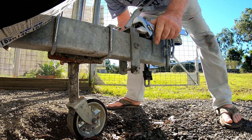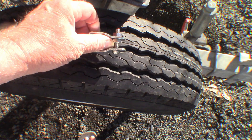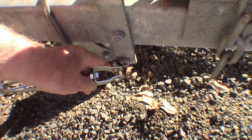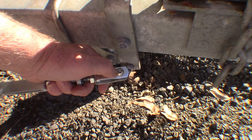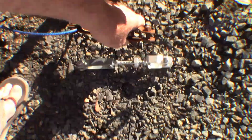This is the stainless steel piece I've got to replace it. What I've had to do is put a 10mm bolt through there, because the bolt that should go through it is about 12mm — half inch perhaps. I didn't want to risk drilling that out and weakening the sides of it, so I put this bolt through the same as I did with the old one. I've done the same sort of deal — put a bolt through it and used that bolt to hold it. So I'll do the same thing and it's time to go ahead and replace this now.